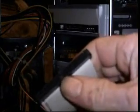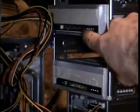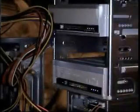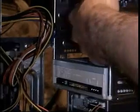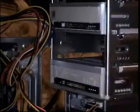You can see it's got a little missing hole right here and a plug in it, so you can't plug it in backwards. The pins on the device you're plugging in are missing a pin also. On the cable, it's got a red ribbon right here — that's always pin number one. Pin number one is always next to the power. Just slide the new one back in, put the screws in, plug it in, and you're good to go.